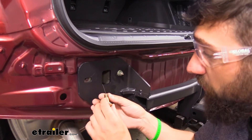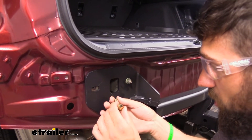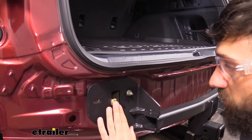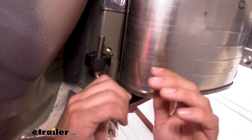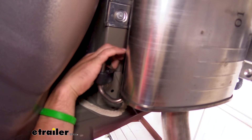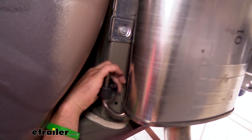A lot of times when you're fishwiring into the frame, there's both a spacer block and a carriage bolt. But this particular one here has the bosses already drilled into the hitch, so you don't need a spacer block. Now we're just going to grab the other side of our fishwire, feed our hardware through the access hole, and pull the other side of our fishwire down through the hole there, bringing our bolt along with it. If you have more than one hole that you need to do this to — and chances are you do — and you only have one fishwire, you want to make sure that you unthread it as opposed to just pulling it straight off.